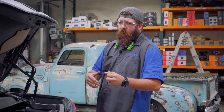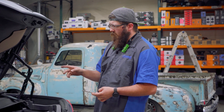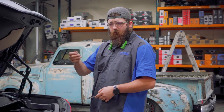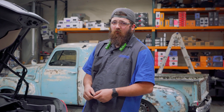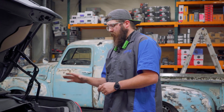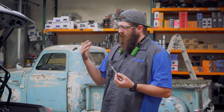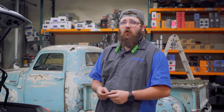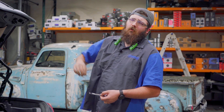To sum things up, this car is perfectly fine — it's just taking a long time to go to sleep. The knocking issue when turning the car on is just the blend door actuator from underneath the dash, because when you turn the ignition on it gives a little knock until it turns off. As far as current draw goes, it's within optimal range for what this car has. Check the owner's manual, see that it's in that range, and there's nothing more I can physically do besides setting up a battery disconnect if they're going to park it more than two or three weeks at a time — which wouldn't surprise me since this is for a dealer and it's a Mercedes, so they're pretty expensive.